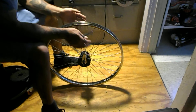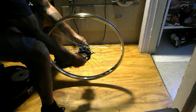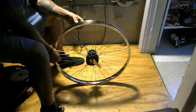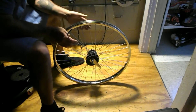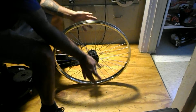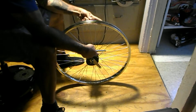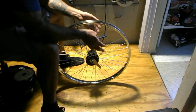It's really simple to keep your wheels in true — you don't need a big expensive machine. You just need something to hold the wheel up off the ground and clamp the axle so you can spin it freely and watch it spin. Get a spoke tool, spin the wheel, and where it bows out, go to the opposite side and tighten those opposite spokes — or loosen them, whichever way it goes — and just keep going until the wheel is true. Make sure your wheel is true before you mount the gear and rag joints or hub adapter, then put it back on the truing stand to confirm it's still true afterward.